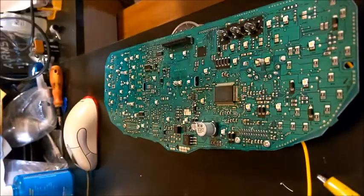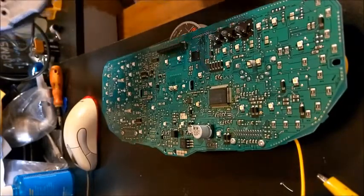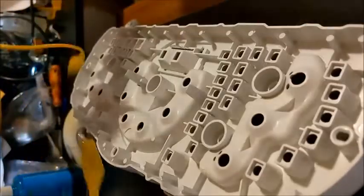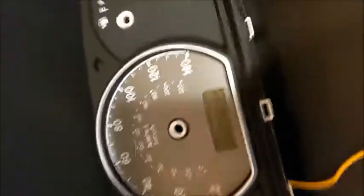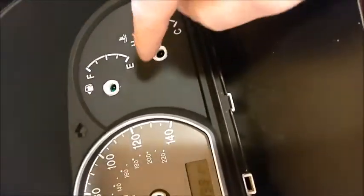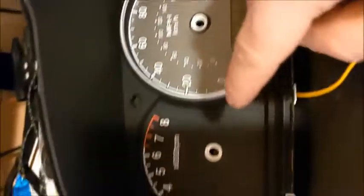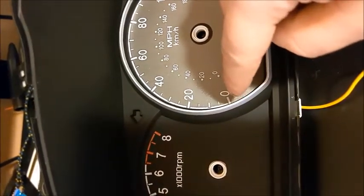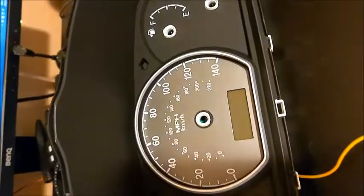Put it back where the LCD is. There are little pins that line up with this piece. There's one extra little pin, so if you put it in the wrong slot the display won't show properly — just pull it out and do it again. After you have it put back together with the pins lined up correctly, hook up the 9-volt battery again and there you go: 350,981. Put the back cover back on, take off the little yellow leads, and when you reinstall the odometer knobs, put them high up, push them in, and bottom them out so they're level. The line should sit just under the white line.